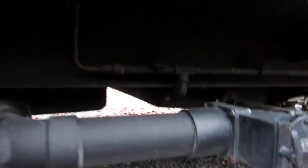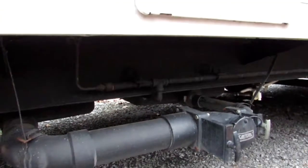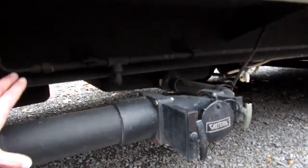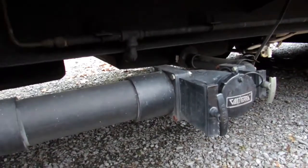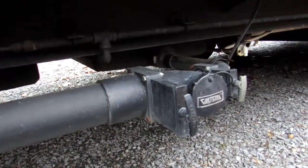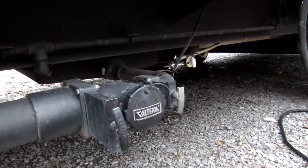Underneath here is your standard sewer connection and drains. It's always very important to drain your big 3 or 4 inch pipe first, which is your black tank, and then your smaller gray tank to flush your line.